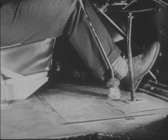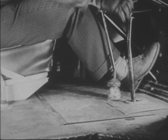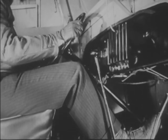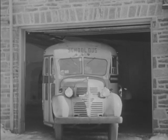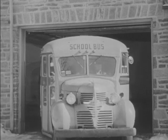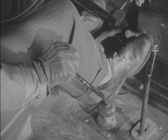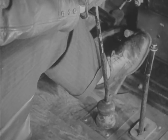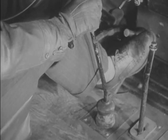To put the bus in motion, push in the clutch pedal, move the gear lever, release the brake, and release the clutch pedal slowly as you accelerate the engine. Make the shift to high gear easily as the bus picks up speed. Shift successively without skipping any gears, and get sufficient momentum before you shift. Don't race the engine in the lower gears.